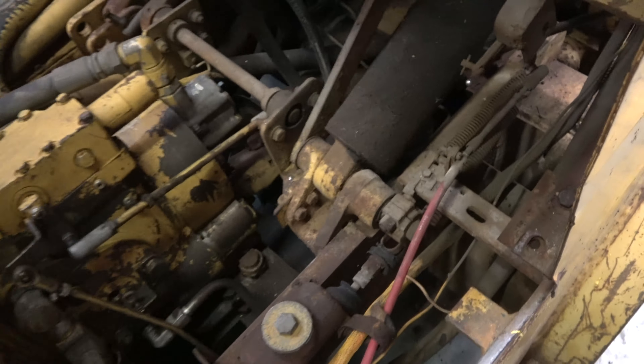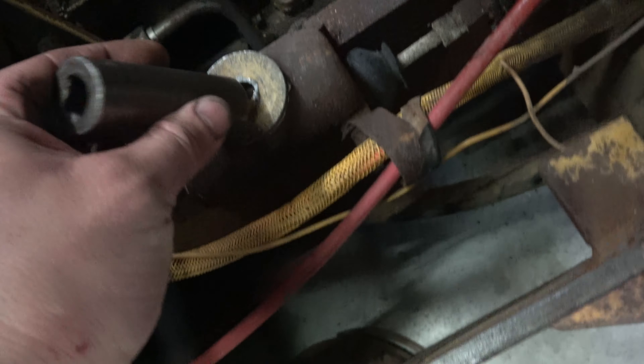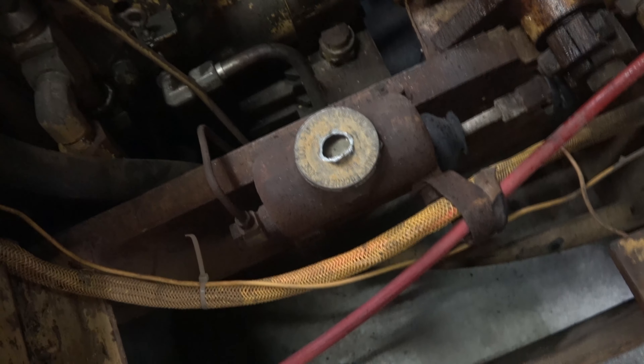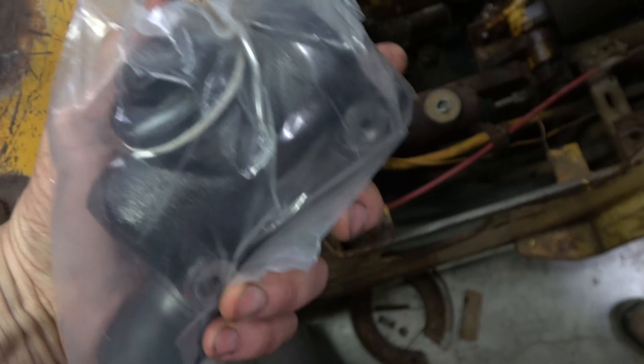I took the floorboards out — there's the master right there. We went to go take the cap off the master cylinder just to see what's going on, and it was tight. We put the impact to it and it just twisted the head right off. But we're going to go ahead and take this master out to see if this brake pedal springs back to where it wants to be. Luckily our new master has a cap on it.